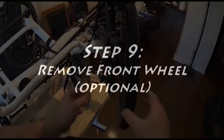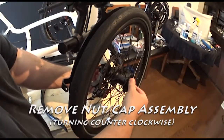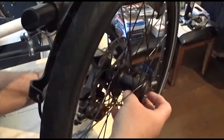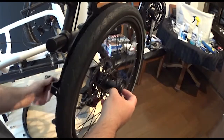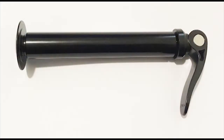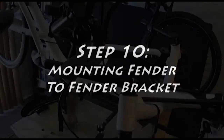At this point you can try to put the fender on, however I've found it's very difficult — I prefer to remove the wheel. Start off by releasing the quick release lever, then remove the cap nut on the end of the skewer assembly. Use your index finger on your right hand to push on the skewer while your left hand pulls the skewer and axle assembly out. Once the axle is removed you can place the cap back on the end to lessen the possibility of losing the springs inside.